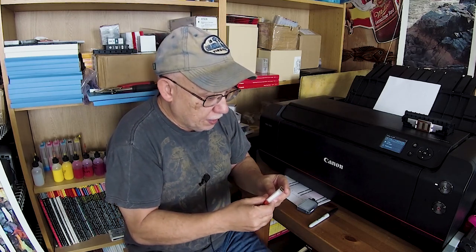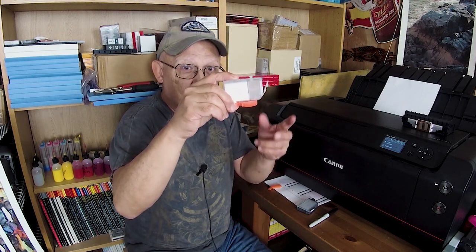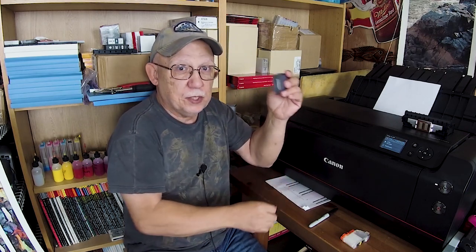To fix that, you have to flush the cartridge — there's no other way around it. At least they caught this before inserting the cartridge back into the printer. Transparent cartridges and sponges will show any kind of contamination or cross-contamination. On a Pro 10 cartridge — PGI-72 — that would be a shock, because you would not know it happened.